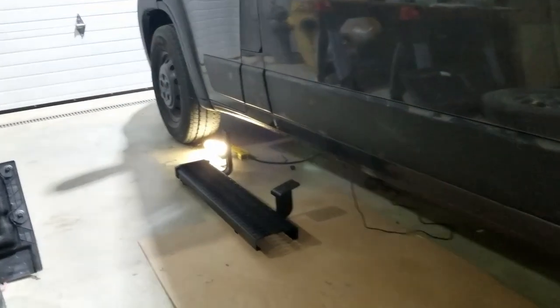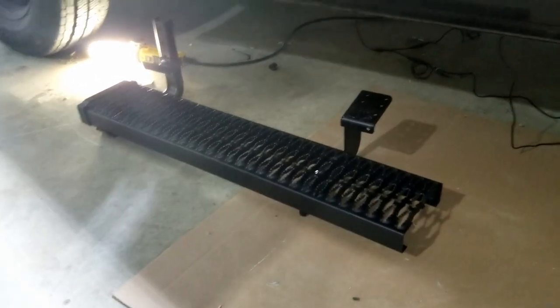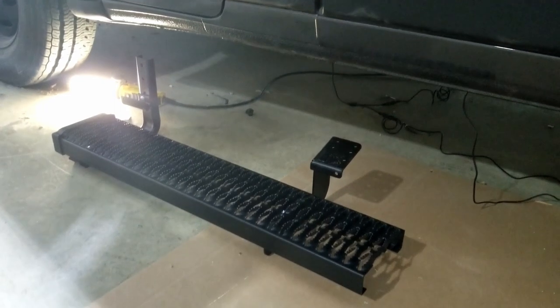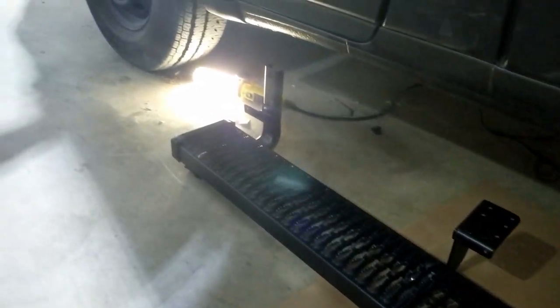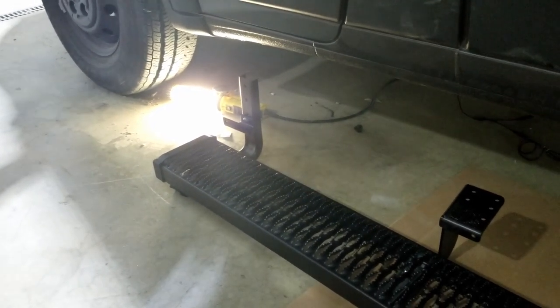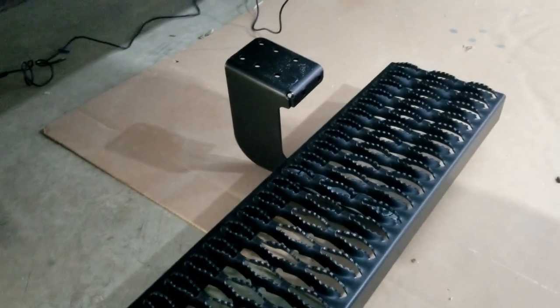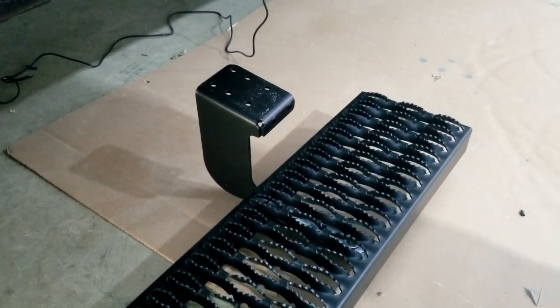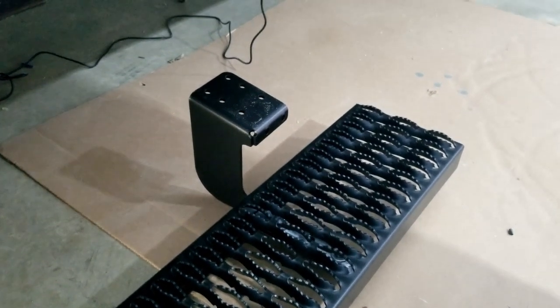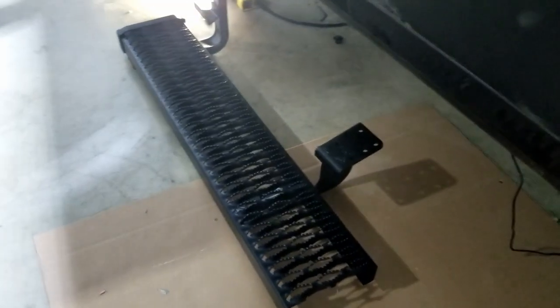Okay, here's the driver's side, and when we put it in, it's very, very low. So what we're going to do is cut the tops off all these brackets, the forward ones, and reduce them by 1 3/4 inches. This one will have to be reduced 1 3/4 inches also. And as you can see, it's got quite a bit of steel on it. So we will cut it, reduce it, tack weld it, and then stick it up again to see if that is more satisfactory.